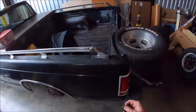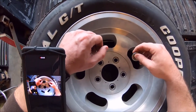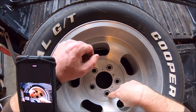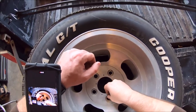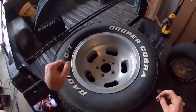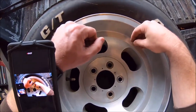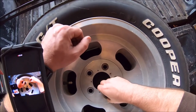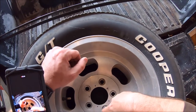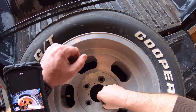The other thing you're going to want to make sure about - most of these are recessed, machined out to fit the washer in. The small washer is a perfect fit, whereas this bigger one isn't. So ideally, either machine it or have it machined to fit the better washers - that would be ideal.